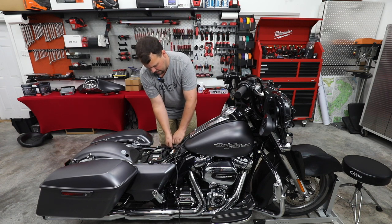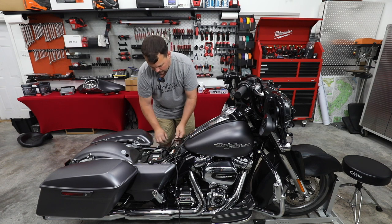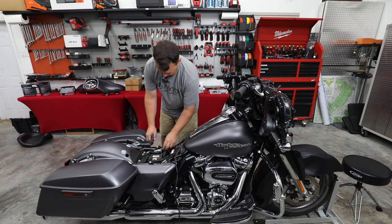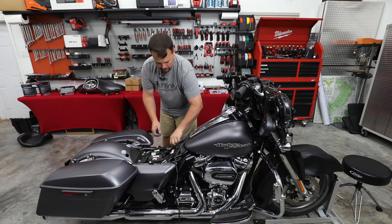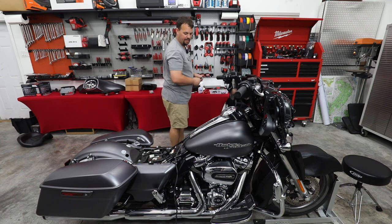We also have a vent here. Fuel return that returns fuel back from the motor. And then we have our actual gauge, which has one zip tie keeping us from unplugging it. So we're gonna unplug our sending unit for our fuel gauge. All right, so those are the three connections on this side. I'm gonna throw some gloves on, let's disconnect the fuel line.